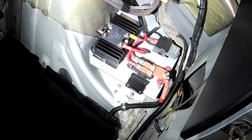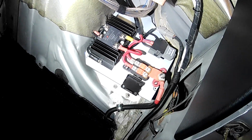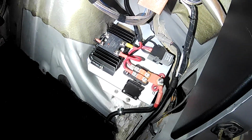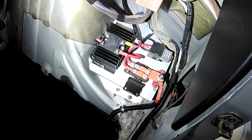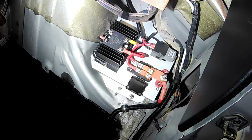I'm actually going to have to pull that out and change it and fit another pump in there, or get another pump hanger, because as I say, things have changed a little bit. I'm expecting a lot more from it now. I want to push the horsepower level a little bit further with the car, so I'm really going to need to run 2 fuel pumps now.